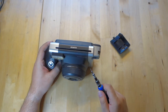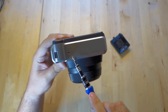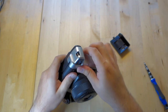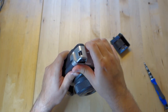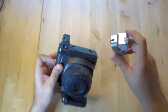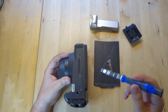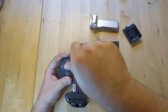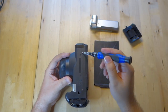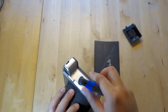I start off with removing all the colored parts, the silver parts. I already removed the screw here, but this is usually one of the long ones. You want to slowly and gently pry this up because there's double-stick tape under here, so you don't want to break this. This is one of the long ones I was telling you about. These two are usually the longest ones, and sometimes the one that goes over here on the silver part.